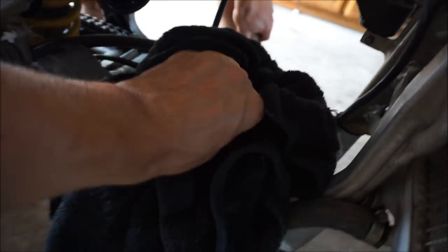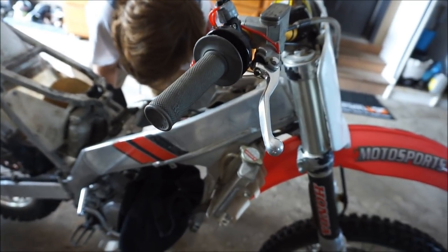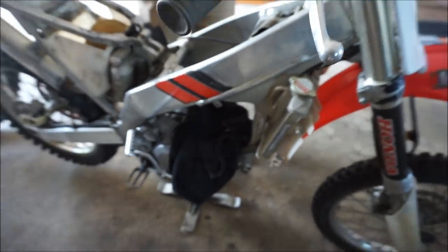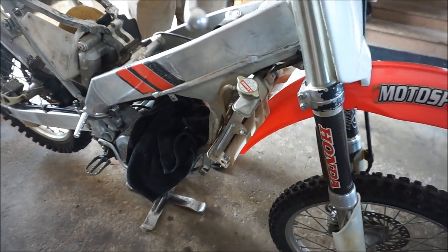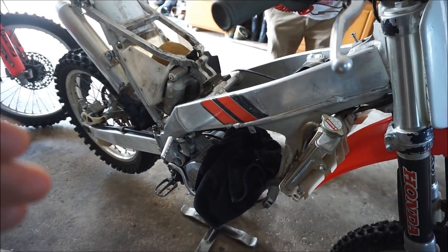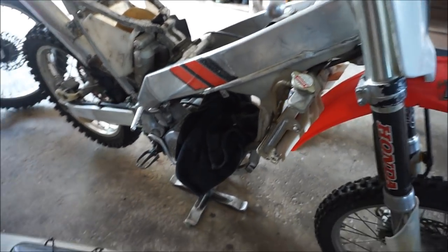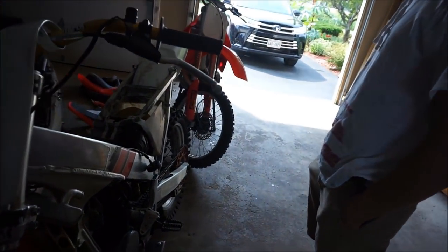So I'm going to slap the piston and the cylinder back in there, hope for the best. I think it's fine. I did some research — I looked up other YouTube videos and everyone said the play on the rod can be back and forth quite a bit, and it's not supposed to be tight. The up and down is supposed to be zero, which it is. I'm thinking what happened is the guy left something in the cylinder and a little piece came up through the piston and scratched it, because it ran fine before. And with the CR500, I think it just needs to be rejetted.